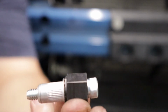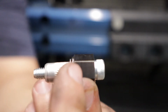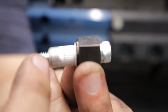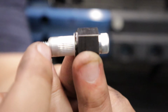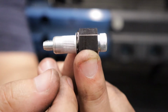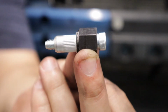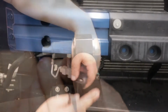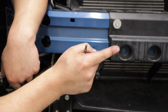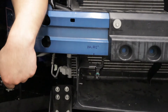And then you're going to tighten the 5mm Allen portion while you hold back the 9/16 hex portion with your wrench until the rivet nut is sufficiently crushed. Once you get significant resistance is basically when you'll know that it's sufficiently crushed. Once you do that, back the bolt out and you'll have a good rivet nut. So you will want to repeat the rivet nut install also for the other side of the vehicle, once you have done one side of the vehicle, obviously.